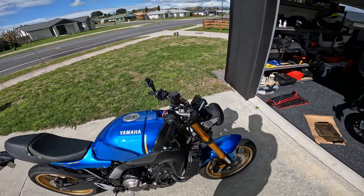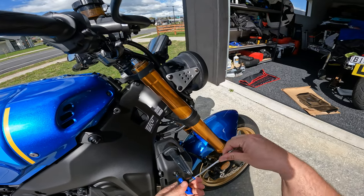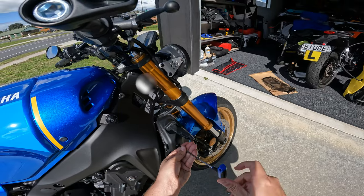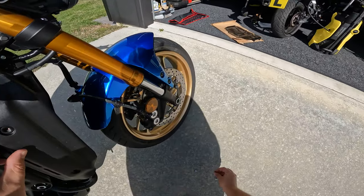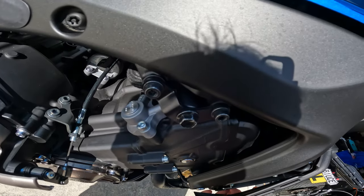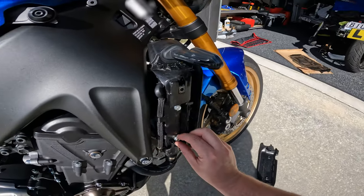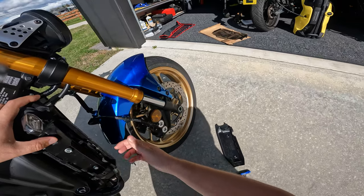Okay, so it's a four millimeter. I'll just take this side off first and see where it goes. It feels real spongy, like it's coming through rubber — must be some sort of dampening in there. So it's got a couple of clips just up in here that this comes up and off. And there are the two bolts I was talking about. Take those off, that peels away and you get the radiator guard in there.